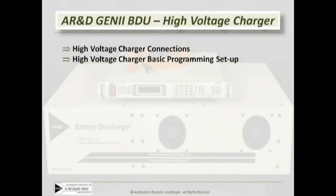Additionally, it is important that the battery modules do not overheat during the charge cycle. Therefore, it may be necessary to utilize a step charging function as part of the battery pack programming strategy to ensure high battery module internal temperatures are not breached. It is critical that proper charging processes and procedures are used to ensure long battery pack service life.